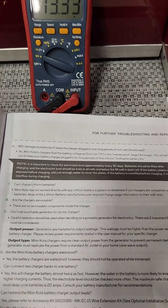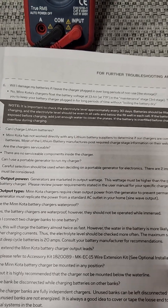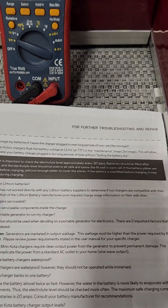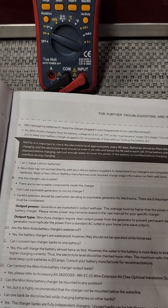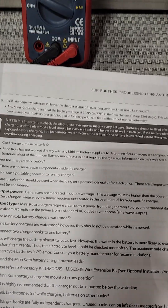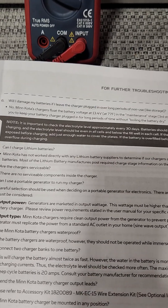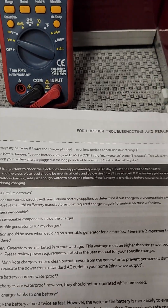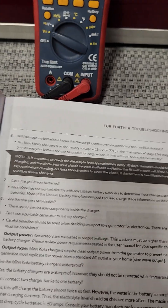The way we store our boats — we shrink-wrap them, check the water level in the fall before wrapping, then run a charge cord out underneath the wrap and plug it in for a day or two once a month over the winter. That's all they really need to maintain the batteries. Since we can't go in and check the water levels, it's best to do that periodically rather than leaving it plugged in long-term when you're not able to check the water levels.